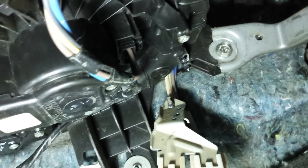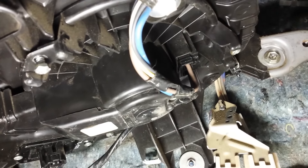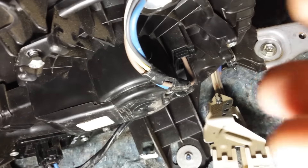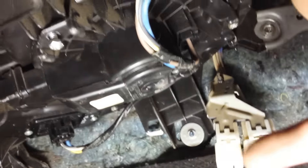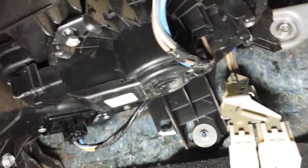There's a clip there — I just had it off already. You take that connector off, and because it's zip-tied right there, I just left the wire connected; it doesn't harm anything. You pull the blower motor straight down, the fan is right there, and you whip it out.